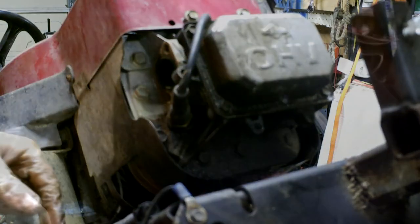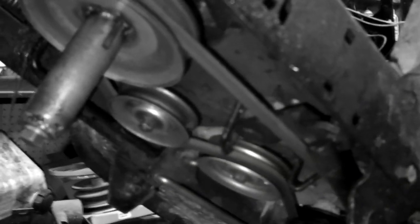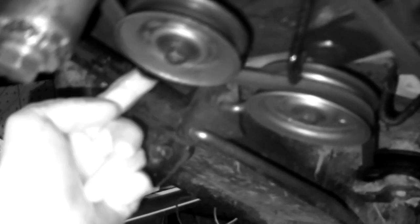I hope you guys are really liking the new infrared feature — let me turn it on, there we go. If you like it, comment below whether this is worth using and helps you. So here's the pulley setup. These are stock keepers that I left on. This one here actually has the stock keeper tab on this side. This is a flipped pulley — I take the deck drive pulley and cut it off with a torch or plasma cutter, then take the stock drive pulley, cut it out, plant it up against the flipped one, measure it, make sure it's centered, and weld the hole inside.